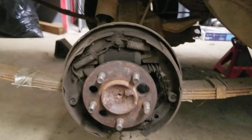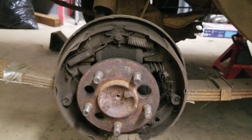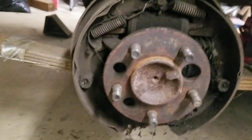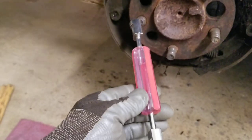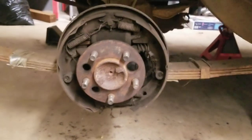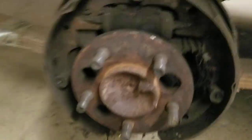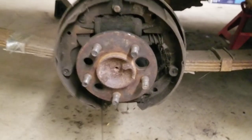What you need to do now is basically take all your brake shoes off and strip it all the way down to the backing plate. What you're going to do is undo your upper springs right here. If you don't have a spring tool, you can use a screwdriver — I have a spring tool, these things work great. And then you want to use this little keeper tool, stick that on there and undo those, and drop your shoes off and strip this all the way down to the backing plate. Make sure you are wearing eye protection. Anytime you're working on a car you should always have eye protection on, no matter what you're doing.